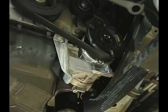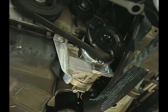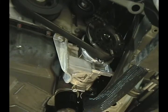This compressor uses a controlled solenoid to reduce or increase the stroke of the five pistons within the compressor by automatically adjusting the angle of the swash plate. An electromagnetic clutch is not needed with this system.